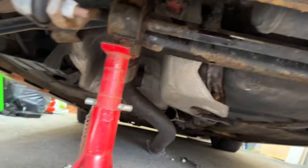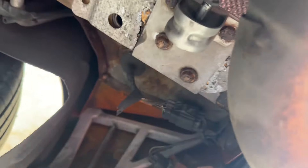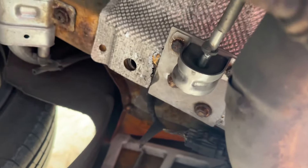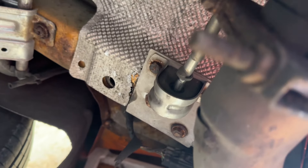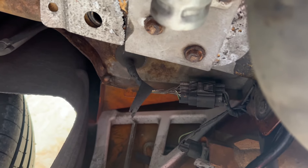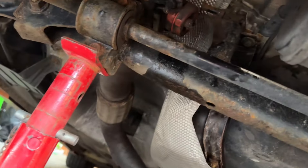Sit rep - the centre section is still on. I've got that hanger off, but this one is completely stuck, rusty as hell. So I'm kind of hoping the new exhaust - because they're both Mongooses - the hangers should hopefully sit in the same position. If not, I'm going to have to go and get a six point socket to undo them because I've only got a multi-point. That centre section is so stuck in there - I've barely moved it. It's right in there guys.